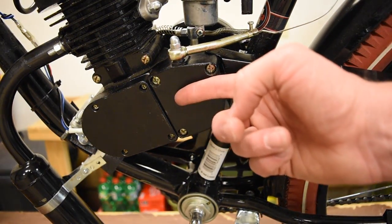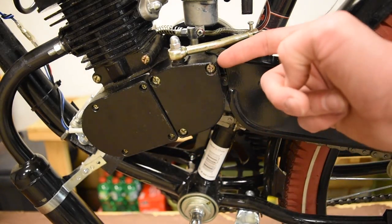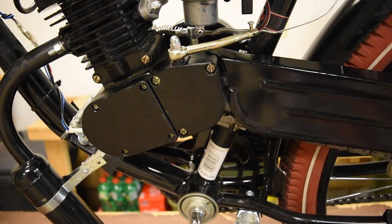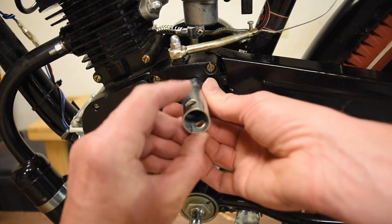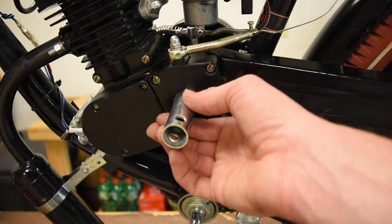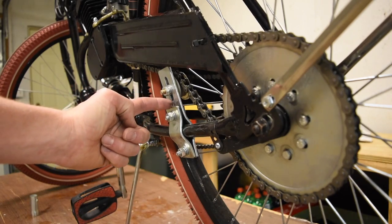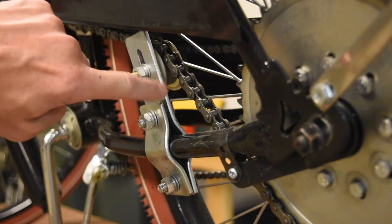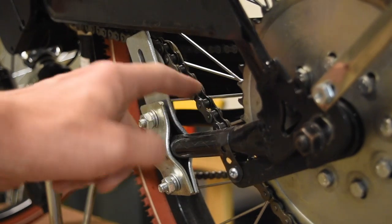I've already installed my chain guard. The chain is running through here and inside there is a little sprocket that the chain runs around. There are three screws you take out — this one is longer than the rest because the chain guard actually bolts onto the back side of that bolt. To get the chain to go around the sprocket, we use the same tool used for our spark plug. Put the chain around, put a screwdriver through here, and spin the chain around. Do not have the spark plug in the engine when you do that, otherwise the compression will make it so you cannot spin it. The chain comes around the big sprocket, then we run it through this tension wheel to keep the chain tight. This is bolted onto the frame — you need that chain to be pretty tight, otherwise if it's too loose it will fall off the rear sprocket.